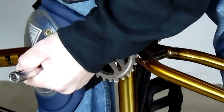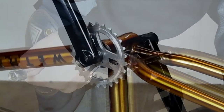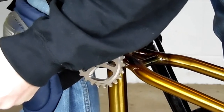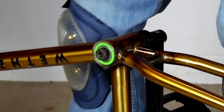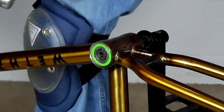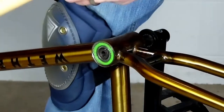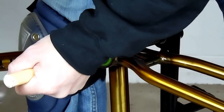If it's a factory install like mine, it's going to take some effort to get it out. I still advise doing little hits, not big hits — just do a lot of them and be patient. Here I switch to a wheelbarrow axle, which is something I can pound on without wrecking my sockets. Once you get one arm off, pull off the drive-side cone spacers and other spacers. Get the spindle flush with the bearing, then use a wooden dowel to punch the spindle through the rest of the way.